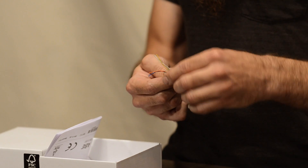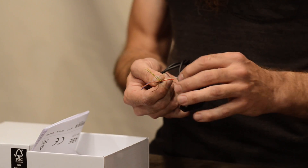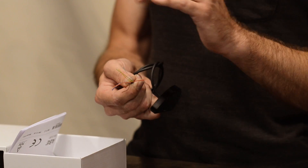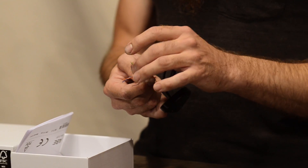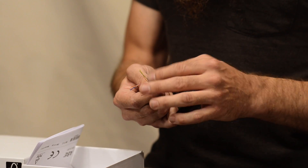The brown wire is a switched positive — that's the one that turns on with your ignition switch and lets the gauge know it's time to wake up and go to work. The white wire is the vehicle speed input sensor; it connects either to the reed switch or your factory VSS vehicle speed sensor. The green wire is for configuring the gauge — cycling through various functions, resetting odometers, setting up menus, and things like that.